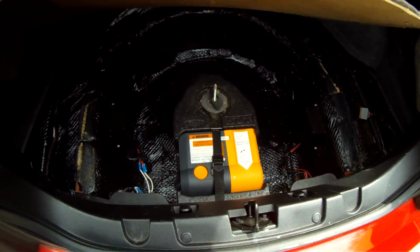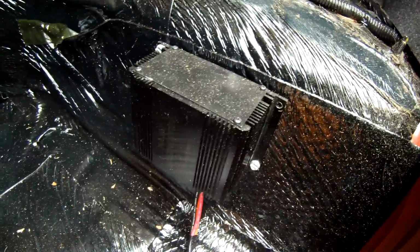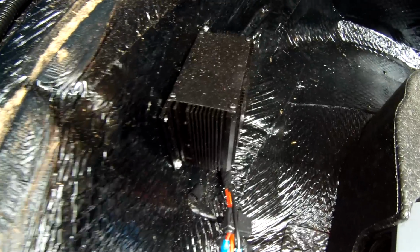I went with the dual VMP tuning booster pumps. I like the dual setup better. That way you have one on each fuel pump driver. These cars come with 2 pumps stock. That way, if one of the booster pumps goes out, you always have one running at least. Possibly less chance of having any kind of major engine damage in the case of a failure.